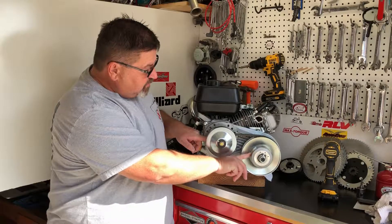Match everything up — keep the flat side to the flat side of the belt, and the bevel side to the bevel of the belt. Very easy. Go ahead and reinstall this. Once you have your belt off, take a look at this bronze idler bushing. Just make sure it's in good shape. You could use a couple drops of oil in here, but what I don't want to see is a lot of oil that's going to radiate out and travel up the face of this pulley. Just a couple light drops, then wipe it down.